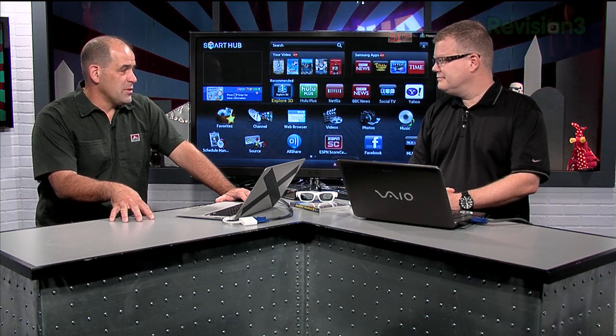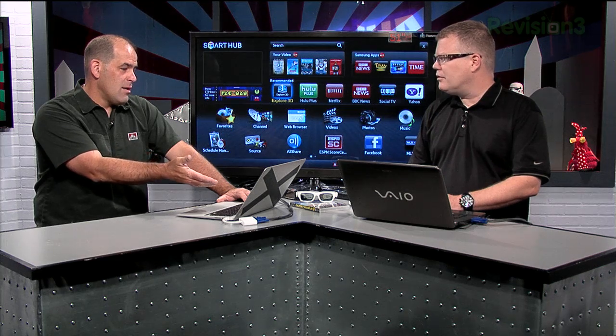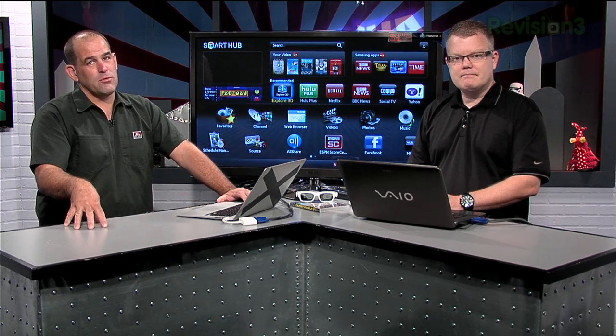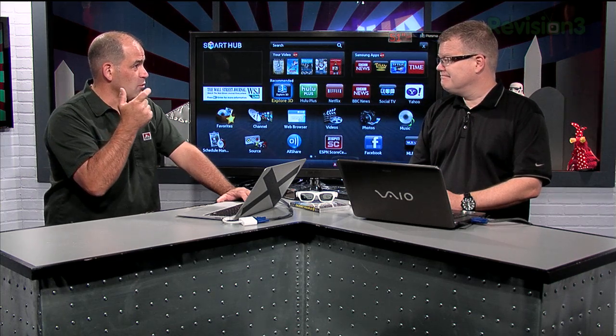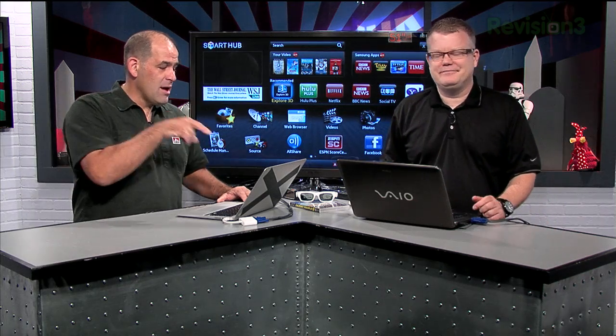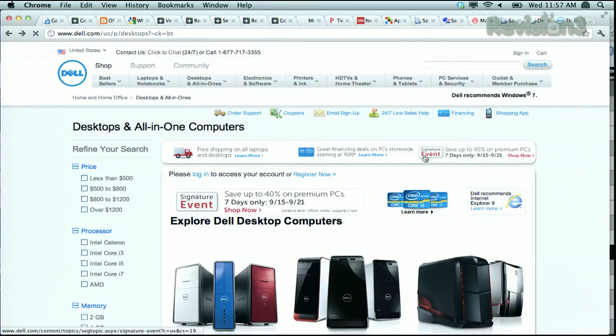Do it yourself? The big thing that makes a home theater PC a home theater PC is being quiet, having a Blu-ray drive, and options for expansion. You might not even need a Blu-ray drive — at this point it's probably cheaper to have a separate Blu-ray player given the cost of the drive plus the playback software. If you want one controller to rule them all, that's the nice thing about a home theater PC. The Inspiron Zino HD home theater PC is gone, so they're recommending you build something based on the Inspiron 620 — a cool-looking small box. A slimline Core i3 is more than enough for basic home theater duties; if you want to do serious encoding, go with the Core i5. Puget Systems also had options for tuners galore — cable tuner to over-the-air — a very nice checkbox option list.